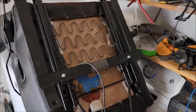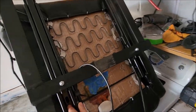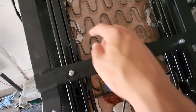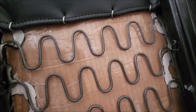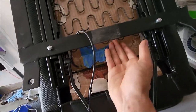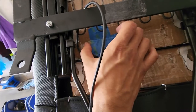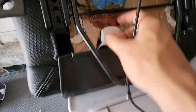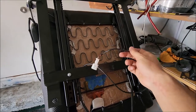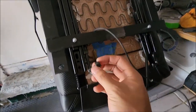Before I put this back in the car, I'm going to show you a close-up of how I mounted the sensor. Before putting the rails in, I used the cardboard and put tape all around it so it could slide in easier. You want the white part facing up towards the seat, because when you sit on it that's where it moves — that's how the sensor detects someone is in the seat. I pretty much put it on the inside part, slid it all the way in using tape, cut a little slit right here just so it could fold in, all tucked in nice.